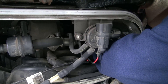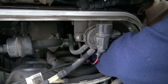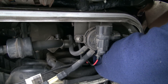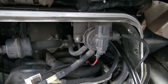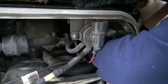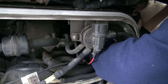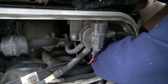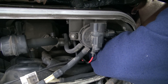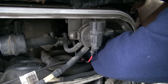Usually you're in emergency mode so you need it right away — you don't have time to wait to save some money. And this saves an entire motor replacement. I definitely wouldn't get crazy over-tightening it, but it is a tapered cutter-type thread, so it's cutting as it's tapering down in there and it just gets tighter and tighter as it goes. So far I haven't had any of these come out when we've used them to repair these motors — they've always done well.